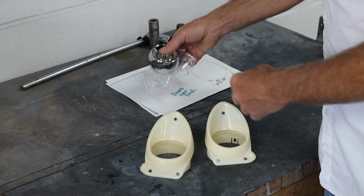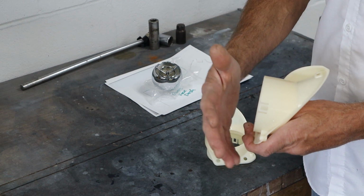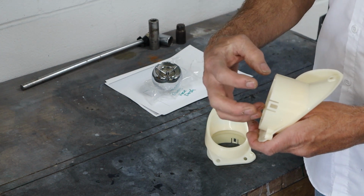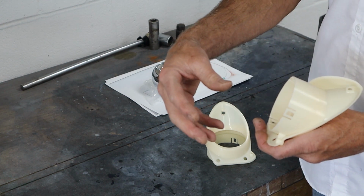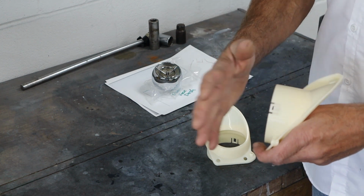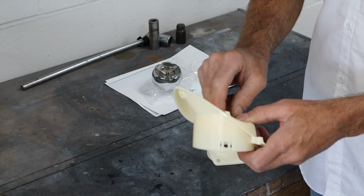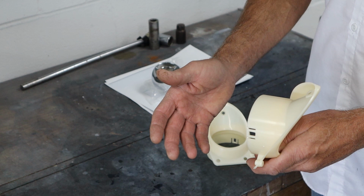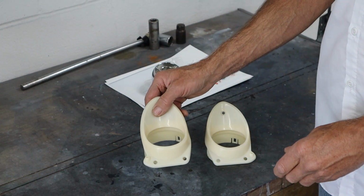Now the piece that goes back behind here that connects this and pushes and holds the ball up is also available from Ames Performance Engineering off the 67 GTO. It's got a 3-inch diameter, and those are on order, so we're going to be test fitting those. Those actually hold, and then the screws hold that ball up in there with the felt to make sure the balls don't flop around and they stay nice and stiff. Then you put your AC line on here. In this case, it'll be from Vintage Air AC line. So that's the plan on that.